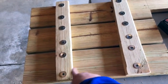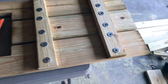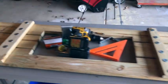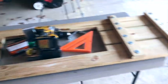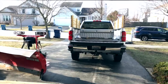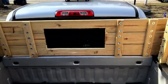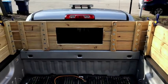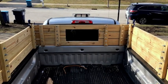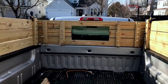These are 1x6s that I split in half to hold it together. For this I didn't use bolts — I just used drywall screws with fender washers, just because it's not holding a lot of weight. It's basically a makeshift headache rack with a window cut out. There it is temporarily installed. I didn't go up higher because I didn't want to block my brake light, my strobe lights, or my bed lamp. As you can see that's plenty of room for the rear-view mirror to look out.